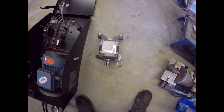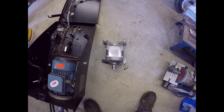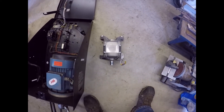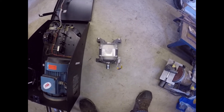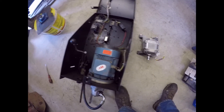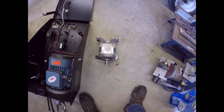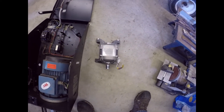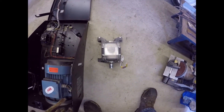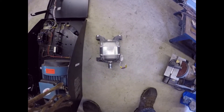This is just a little experiment - this motor is a DC two-speed motor of some sort. It's not a permanent magnet one, it's got electric magnets in it. It's out of a Samsung washing machine. According to the spec on it, it's 90 volts for the low speed and 230 or 220 volts for the high speed - obviously a wash speed and a spin speed. It just needs a DC power supply.